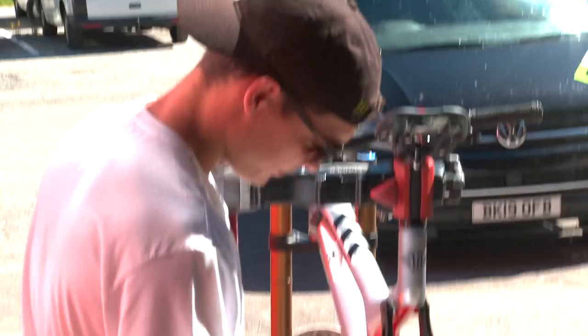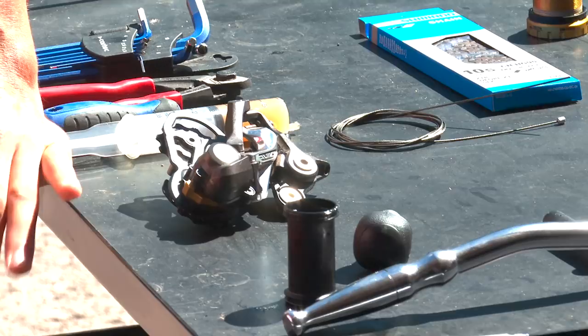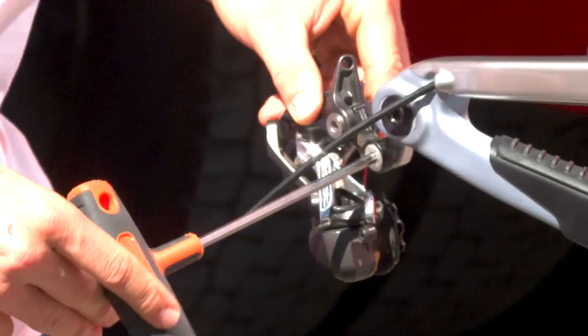So now we're going to install the rear derailleur, the Shimano Saint 10-speed rear derailleur. Carrément. So yeah, Shimano Saint, there's never any issues with it. Just really good shifting. Every time there's a lowish crash, I just change it, because you never know. We're racing, we want to be sure the derailleur is perfect on a race run, so I change it after a lowish crash. If it doesn't crash, I keep the same one for a long time.